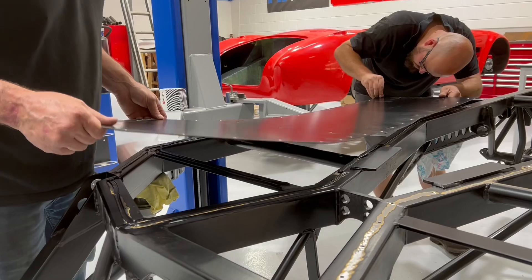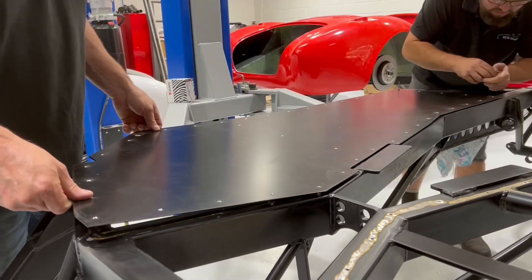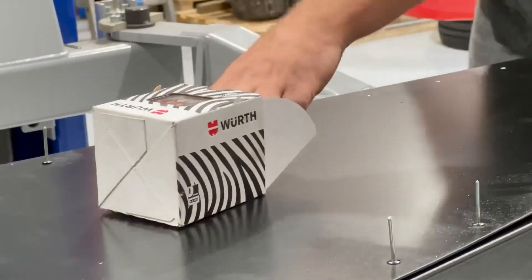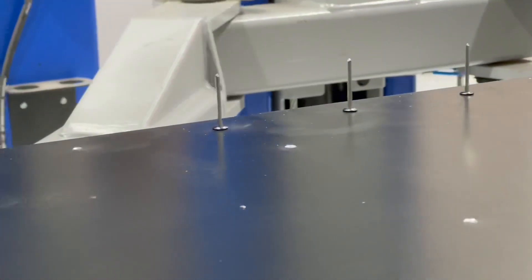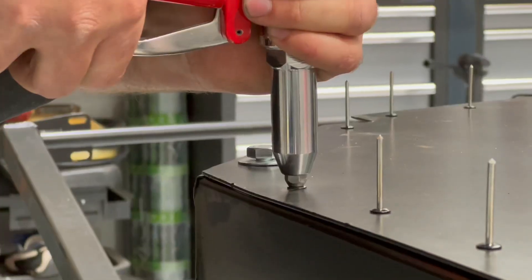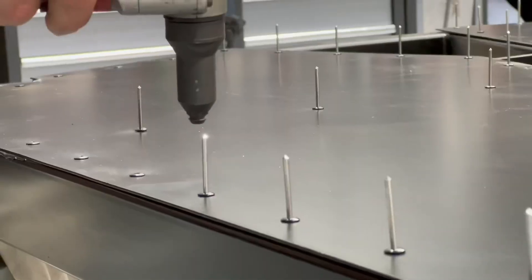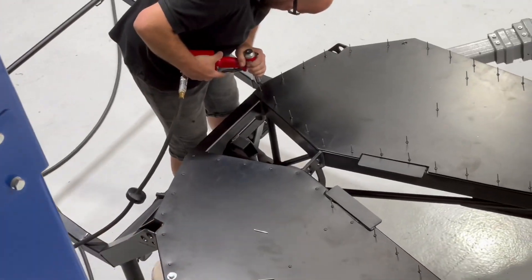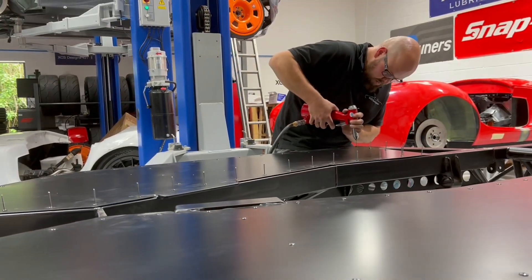With a friend, it's always much easier to put the floor pan into position. If you use a rivet in one of the holes, you'll notice that's a very easy way of getting alignment on that first hole to make sure you're perfectly in position. Then simply go around, putting them all in the 4.5mm holes that you've drilled. Make sure they're all there. You can either use a hand rivet gun or an air rivet gun — whichever one your budget or workshop dictates. Both do a wonderful job.